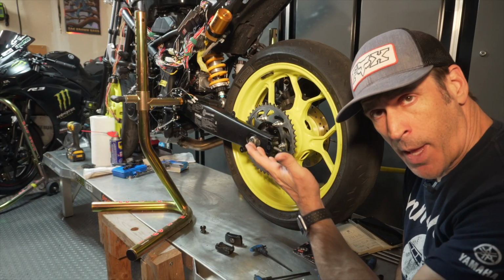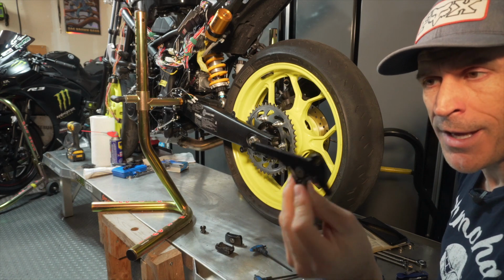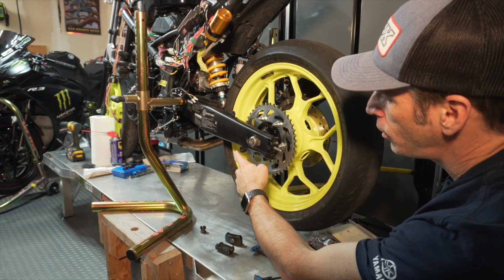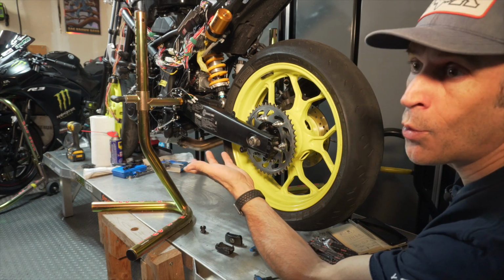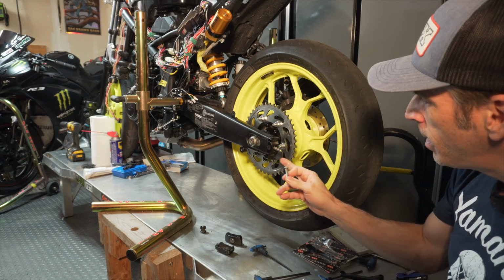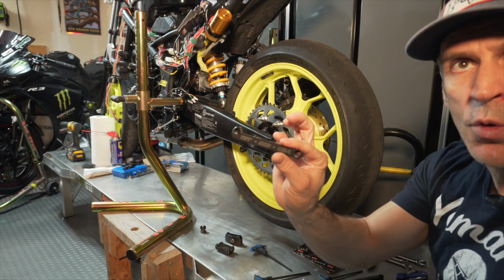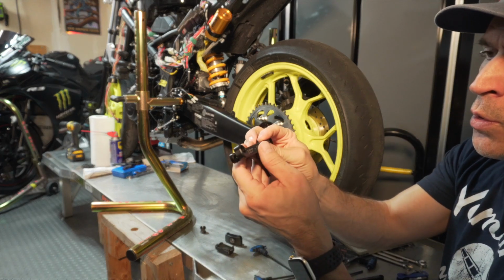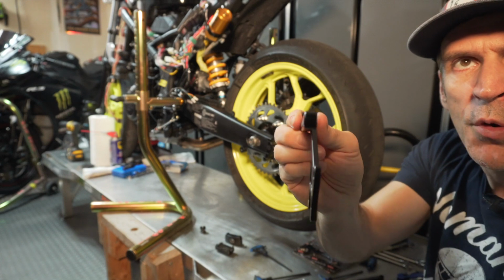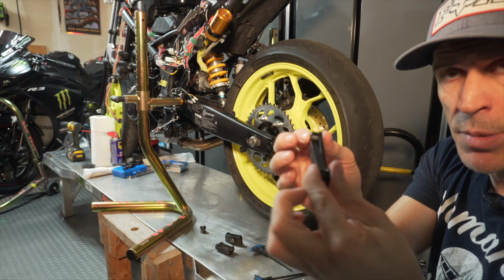Okay, so now that the end cap has been installed with the spring inside, obviously, the next step will be to install the bracket for the GP lifter, and that bracket will connect in the front to the area where the spool would normally be or was, and in the back you were given in that package a long bolt with a nut that will secure this bracket in place. And in my case, as I mentioned in the intro, I have these Delrin sliders that will go on top of this here and will offer some extra security. So you can see the thickness here of both items. So this is the Delrin slider that will simply go on top, and the bolt will hold everything in place.